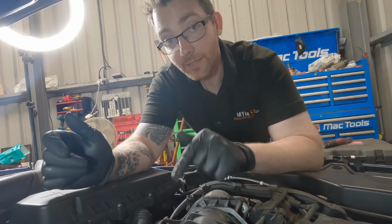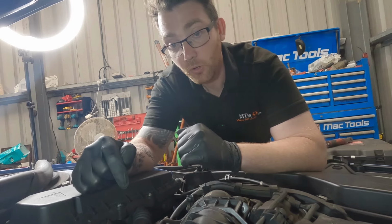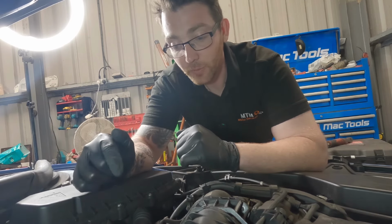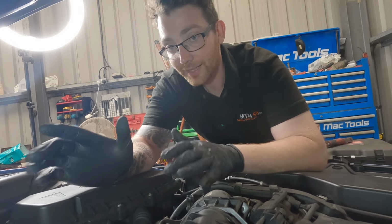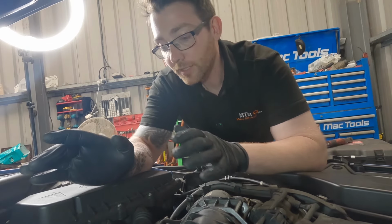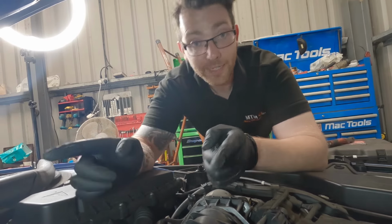So in the meantime, let's go strip it apart. Because we're so close to the alternator and there's some exposed positive wires, it's always a safer bet to disconnect the battery. That way, if you drop your ratchet and anything like that, you know you're safe and it's a safe area to work on. So yeah, electricity and water don't mix, so it's better to be safe.